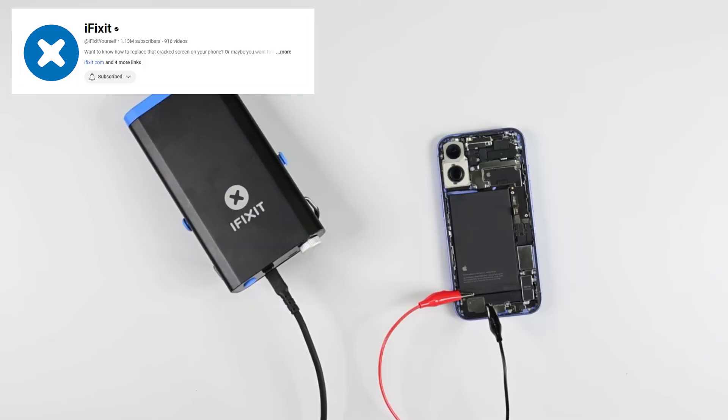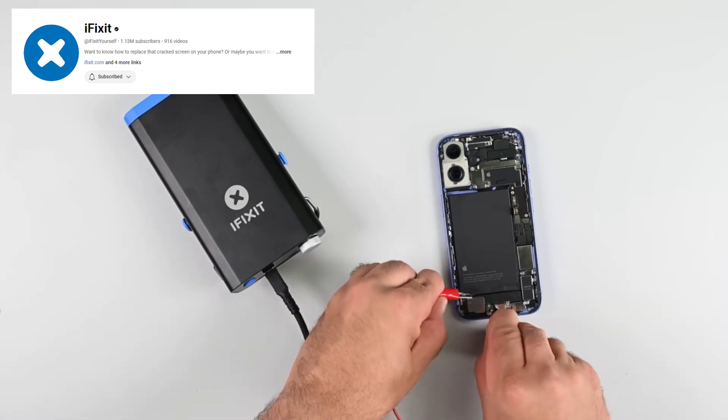There are some really cool changes with the iPhone 16 series. The iPhone 16 no longer has a battery with the same type of pull tabs. Using a nine-volt battery, you connect one of the leads at the bottom of the battery to the ground using alligator clips. In about a minute and a half, the adhesive will let go and is reusable. After disconnecting the power source, there was no trouble at all pulling the battery out.